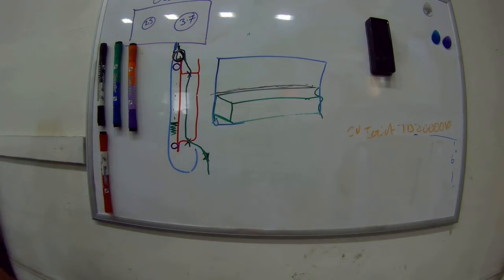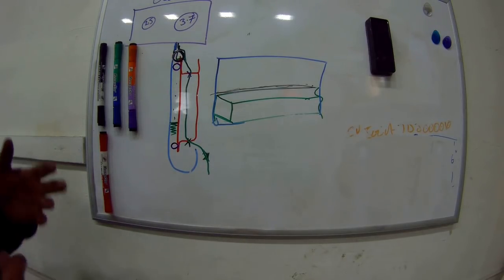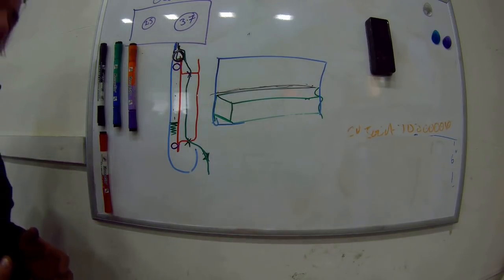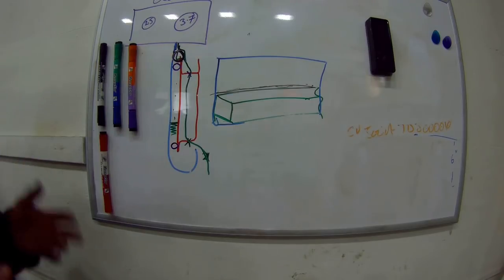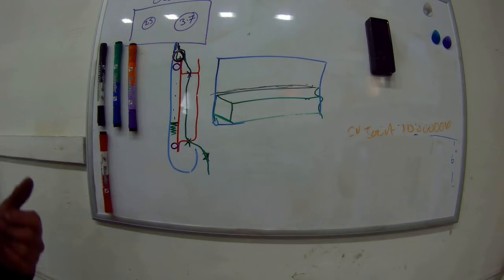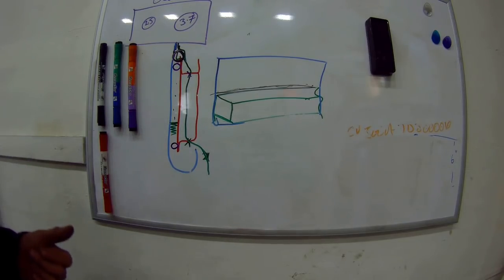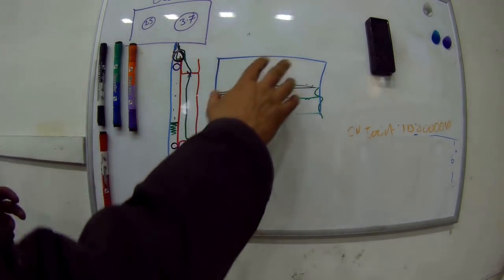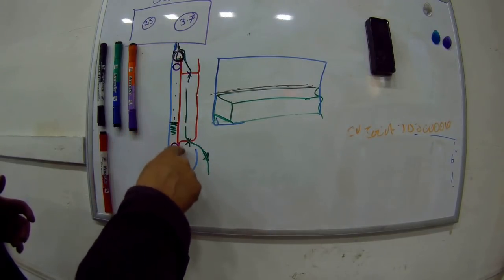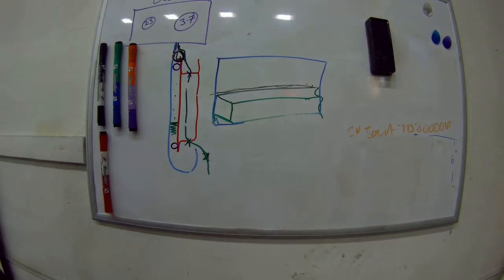It has to be a liquid stuff. And the inconvenient thing about the liquid rust proofing, or the very runny rust proofing, is that in summertime it can get warm and run out, and it washes off if it's under the car. But believe me, it's worth its weight in gold. So spray inside of that door, spray inside this cavity, spray around the bottom. You can't put enough rust proofing on a Land Rover, believe me.